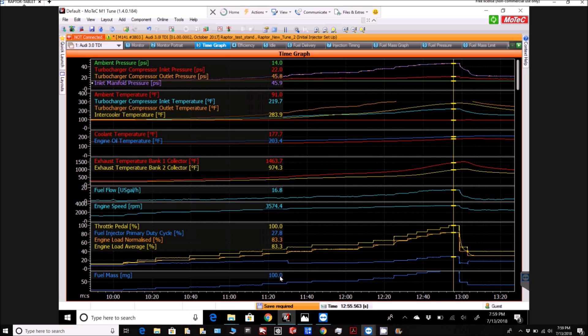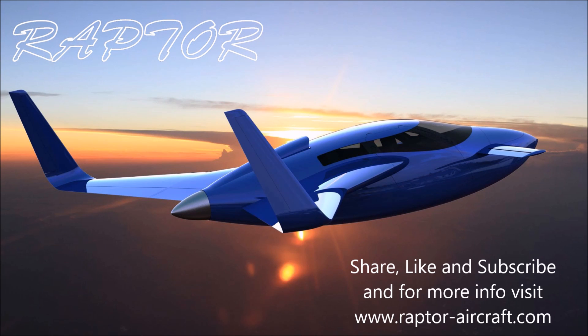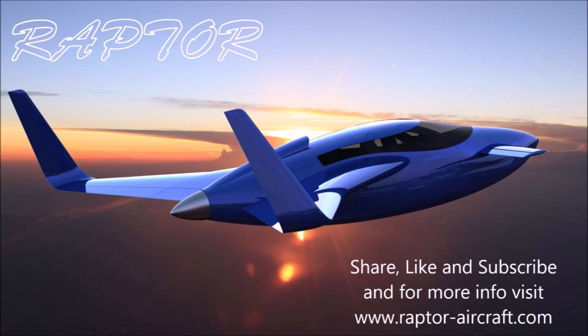The EGT went over 1,500°F — the red line is turbo number one and the yellow is turbo number two — much hotter than the exhaust going into the turbo, which was around 450°F, so nearly a thousand degrees more coming out. The maximum boost we hit was 46 PSI total, which is over 14 PSI ambient, so about 32 PSI of boost altogether. I'd love for you guys to chime in on what you think the highest safe temperature coming out of the exhaust and out of the turbo should be — that feedback would be really helpful. Anyway, that's our update for this week, thanks for watching.